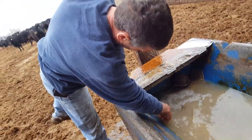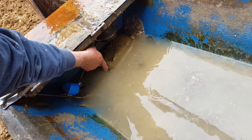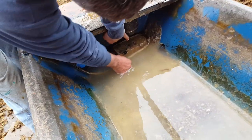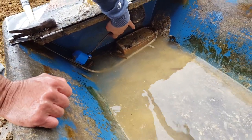The calcium from the water and the seeds have collected around this element, which makes the element work really hard. It makes it overheat and thus burns it out. You can see how thick the buildup is on here already, and this element is less than a month and a half old.